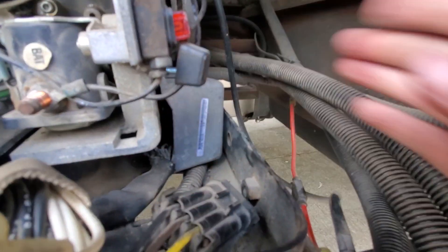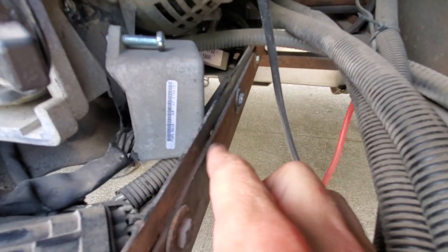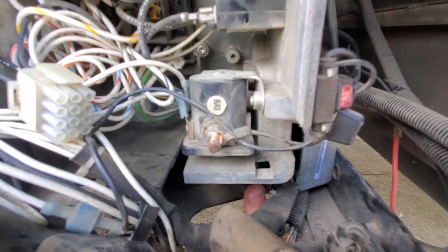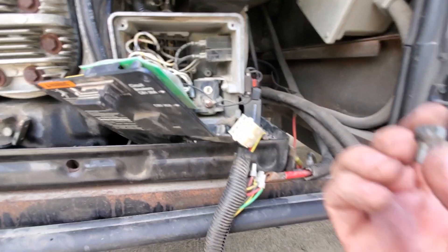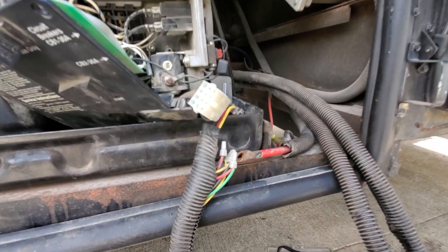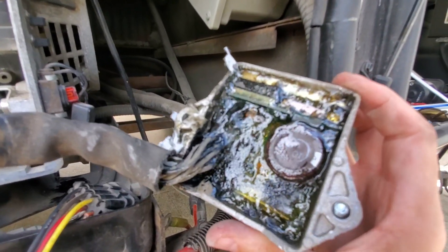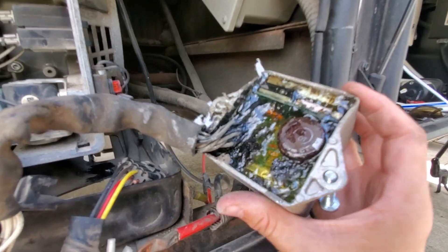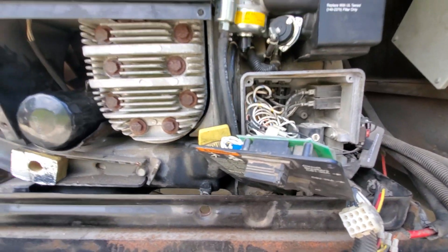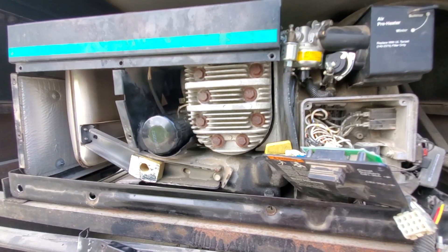The bottom one, not so much, because there is a hole on the frame for access, but because of the way it's mounted in the RV, it's blocked and you can't use it. So I was able to come up underneath with a 3/8 wrench and undo it from there. Mine on the bottom had a 3/8 hex head — it's still T30 on the face, but was able to do it like that and get it loose. It turned out mine is in fairly rough shape — all the epoxy has started dripping out and making a mess inside here. So I'm going to replace that and hopefully that'll be it. I hope this video was helpful — this is a video I wish somebody had made for me. Thanks for watching, and share this with others if you find it helpful.